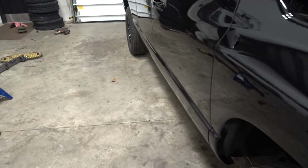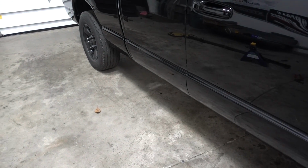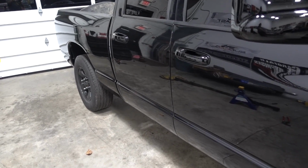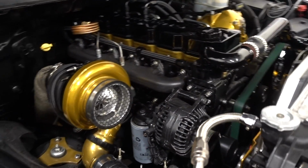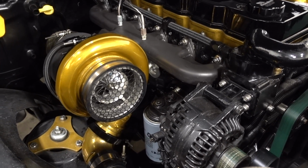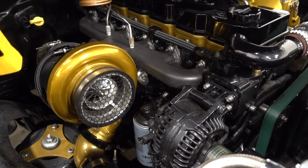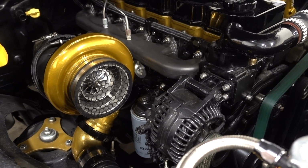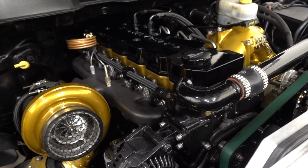Like I said, last weekend or the weekend before, best 60 foot of a low 1.4 on that. So we're going to keep the tire pressures the same as last week. CalTrack settings the same. Really just a bigger tune with some more fuel in it and a bigger charger. And I believe the best that we ran on this year with this setup is a 10.5. So hopefully we can get a little bit better with a better 60 foot and do well. I hope that we can beat quite a few people there.